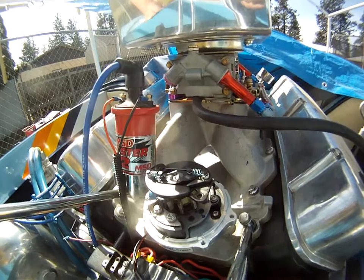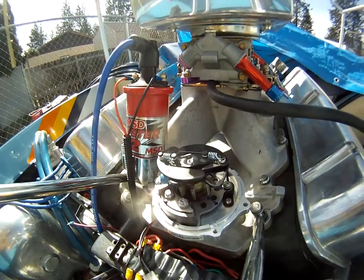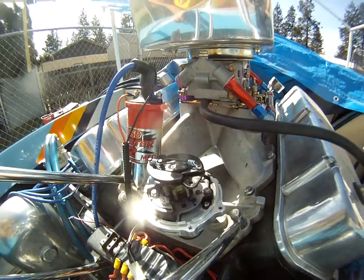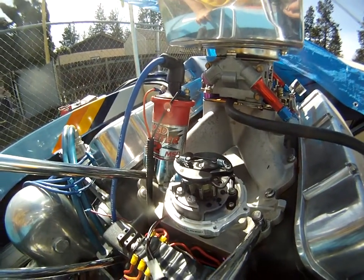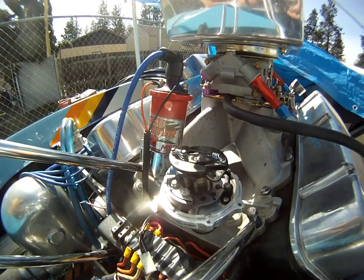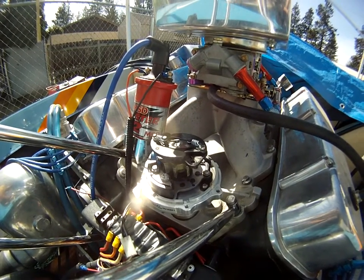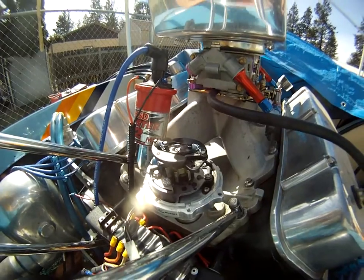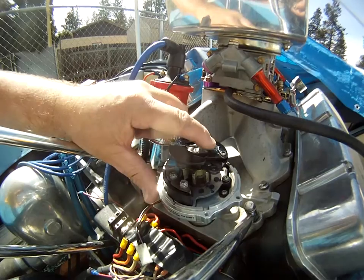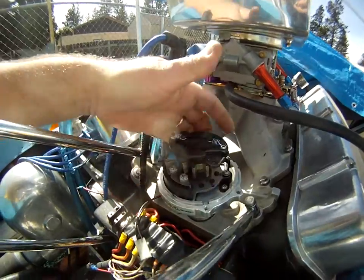So I've discussed that. The air gap is 018 to 030 according to MSD instructions, and we've covered rotor phasing. The next thing I want to talk about is these springs. It depends on the engine you're running. To give you an idea of what General Motors does with their stock HEI distributor — you usually get total advance on a stock HEI at 2500 RPM. So in theory, if I used a blue spring and a light silver spring, I would add the blue bushing underneath.